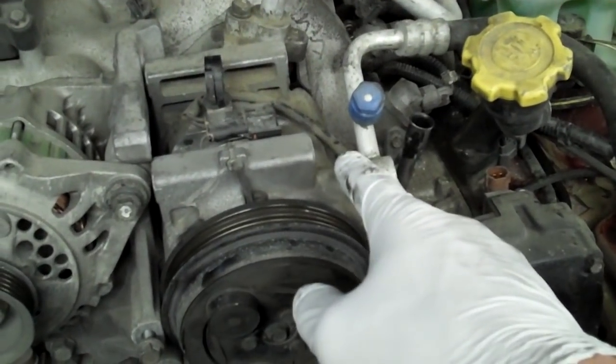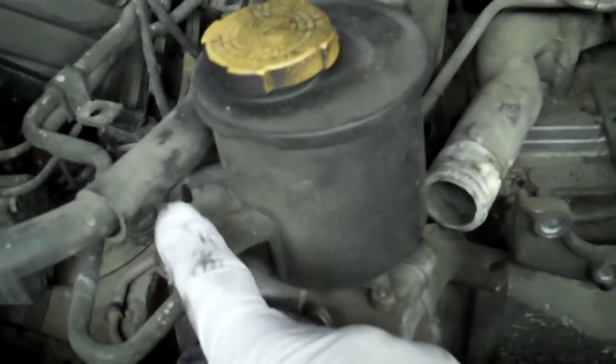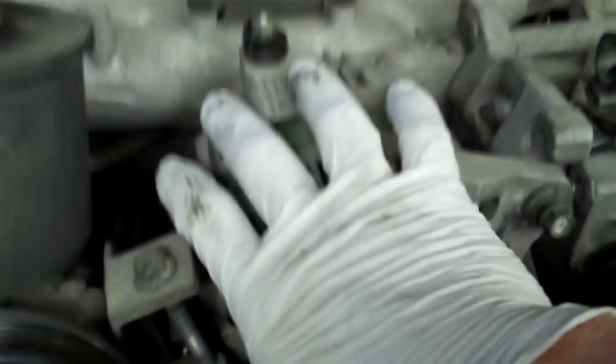There's a belt tensioner and a bunch of other stuff. To get all this, you have to loosen the bolt on the alternator right here. You have to pull out another little bolt that goes to a little bracket that's gone now here, and then there's another little bolt that goes on the end here. Here it is. It's over here now on the power steering pump. Once you loosen this bolt here and this one to take the bracket out, you can push the alternator down, unplug it, string the wire harness out, and then you're able to detension the belt for that.